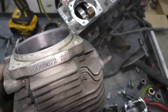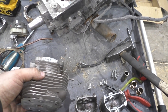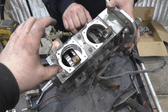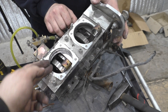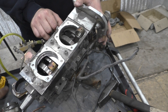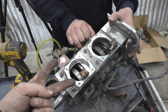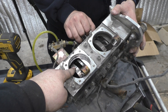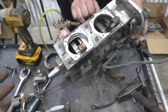This is done on forced two-stroke engines, indicating that the engine operates exclusively at high speeds. The cylinders are arranged oppositely and they work in pairs — ignition and a working stroke occur simultaneously on a pair of cylinders. One of the features of this engine's design is that two cylinders share one common scavenging chamber at the crankshaft, and they also have two carburetors. Usually, one scavenging chamber is made for one cylinder for efficient operation, but there is simply no place to do it here. Moreover, at high speeds the engine system works normally.